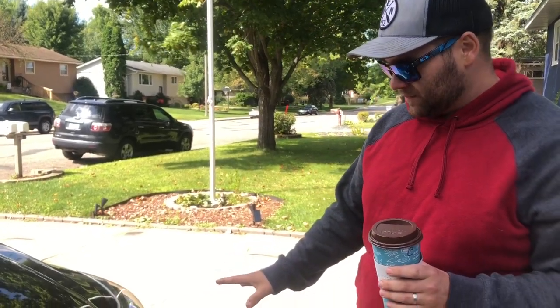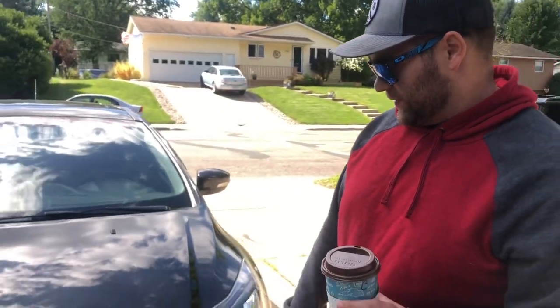I couldn't stand it. Felt like something was wrong with it, but I actually knew it was the blow-off valve because I asked him if he did a boost reference. He said, I don't really know what that is. And I knew he put the blow-off valve in, and it didn't feel adjusted right. So I ended up buying it anyway. And it ran great. I mean, other than that, on the highway, it was cruising fine. Wasn't having any weird misfires or anything.